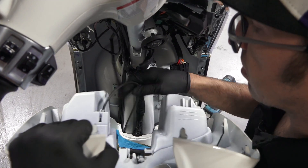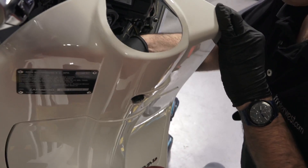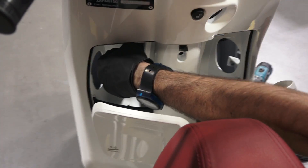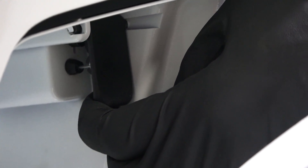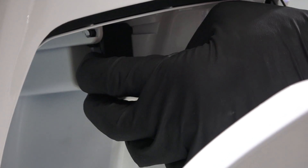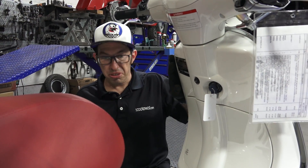The last thing you have connected is the mechanical seat pop cable. Often I don't bother disconnecting this if I don't need to pull the glove box completely away. Open the glove box again — there's a little tab you can access to click it back open. To remove the cable, you'll need needle nose pliers to pull the cable out and dislocate it from the lever. Do this very carefully, as it's probably the most difficult part of the removal. I'm going to leave it alone for now since it won't affect anything and I can keep the glove box close to the scooter.